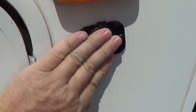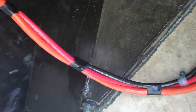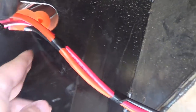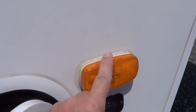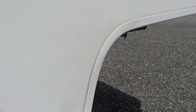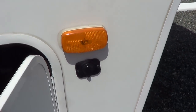So that looks pretty good — a nice little port. On the inside, the wire comes out and I tacked it to the side and ran it up through a convenient hole where the propane line comes from the tank on the other side. There's also an orange wire in there — I had trouble with my running lights getting shorts where the wire goes from one side to the other; it was pinching in the corner, so I just ran a new wire across. Let's go inside and I'll show you how I wired it into the battery bank.